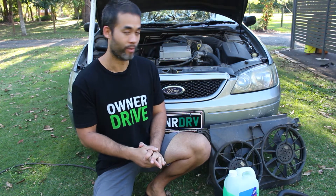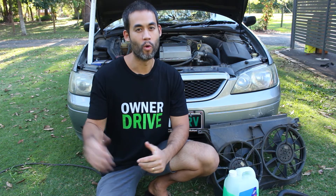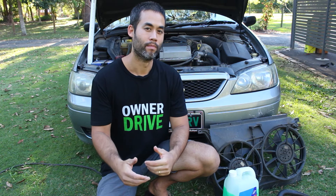Let's focus on the radiator. The radiator has a very important function — to cool things down as the coolant passes through it. It does that with assistance from the breeze as you're driving, but also the fans. Your radiator does tend to get clogged up over time. If that's happening, you're likely to see your car gradually warming up — the system is trying to keep up but can't because the radiator is not cooling as efficiently as it normally does. If your radiator has a problem these days, you're best off just getting it replaced. It's not a huge job and you can normally get aftermarket radiators at a reasonable price.